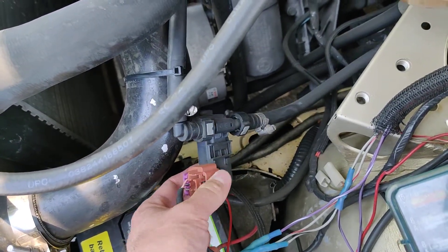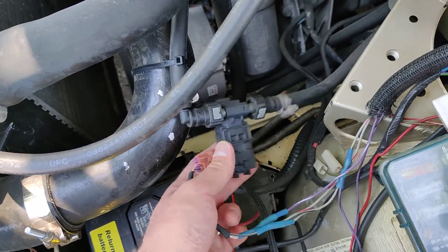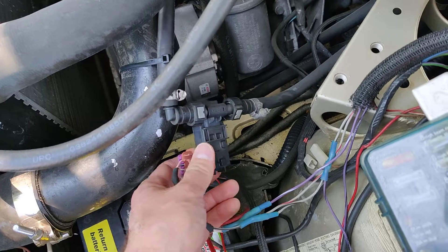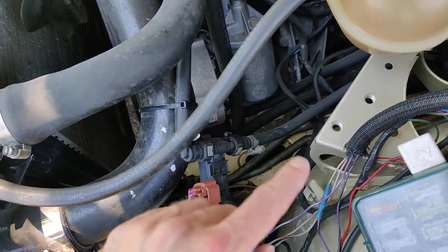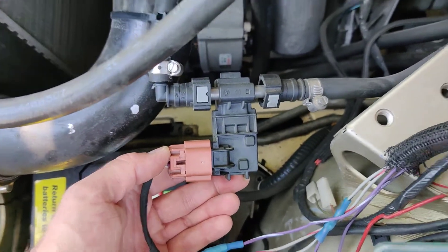It's best to have it in a low area or in a more flat orientation to allow a consistent stream of fuel — basically a puddle of fuel that it's sitting in at all times. So that's it: three wires, sensor goes in line on either the pressure side or the return side. Return side is probably the most common.